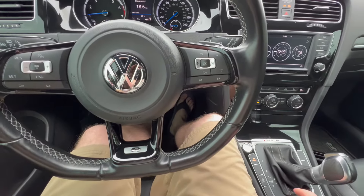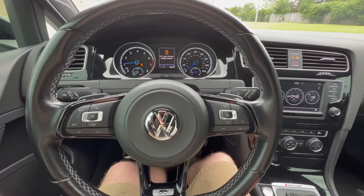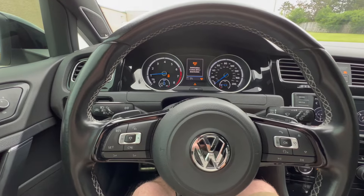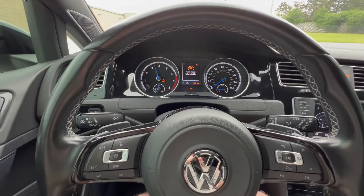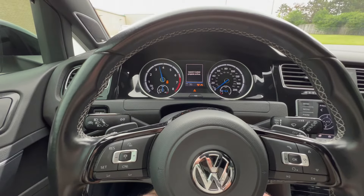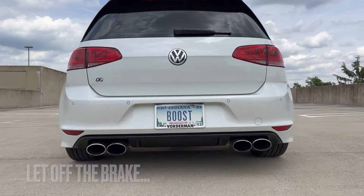Put your left foot on the brake. Then you're going to hold the traction control off button. It's going to say then that bing — go hard on the brake. And it'll tell you launch control is activated. And then just let off and go.